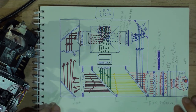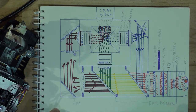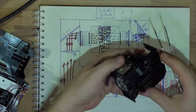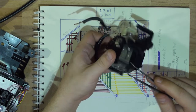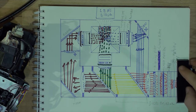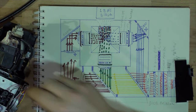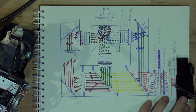So we're going to go over the circuit and I'm going to show you the actual engine inside. First there's a bulb — the HMI bulb or whatever type — and after the bulb there is a lens which is included in the bulb assembly. Then there's a spacing with nothing in it, and then a lens. After that the light goes straight to a piece of glass which looks like a multi-lens — it's actually a square piece of glass with multiple small tiny lenses in it.